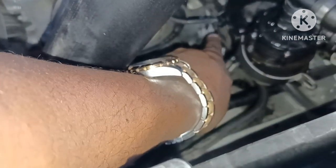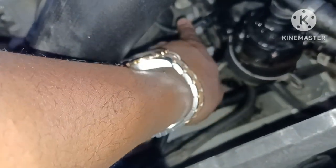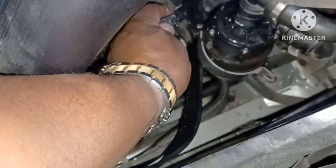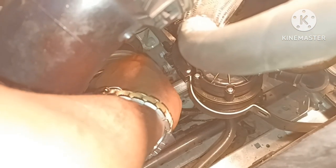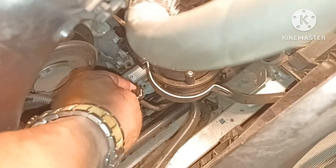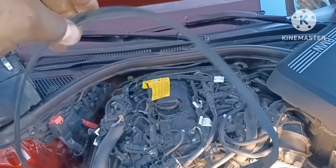There's a wire right there sitting on a little retainer clip. Once I get that retaining clip out of the way I can pull it off. There's the clip — it goes right around this little metal piece, and all you do is pull it hard enough because it's got little shark-bite looking teeth that latch on. Pull it hard and you get the belt free. There's my old belt.